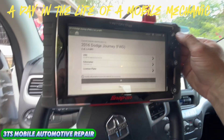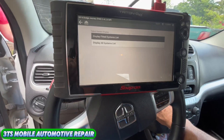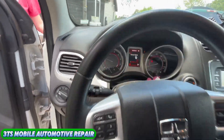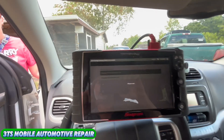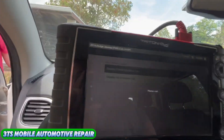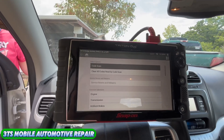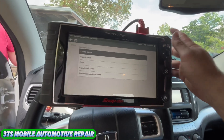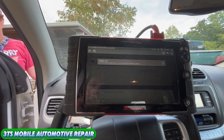All right, 2016 Dodge Journey, ABS light. Let's see if we can scan this thing. Display fitted systems — the ABS, airbag, traction control, all those lights will come off and go on. If the fault is not present at the time, it will turn the light back off so the system is functional again for safety. Check engine lights or tire lights are usually the ones that will stay on until it runs a certain number of times or we clear it ourselves.